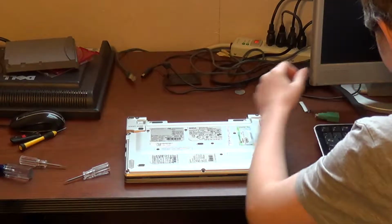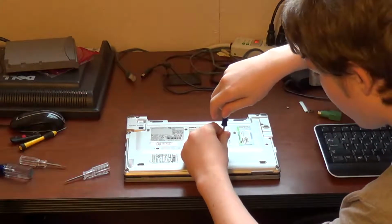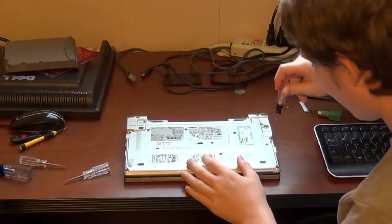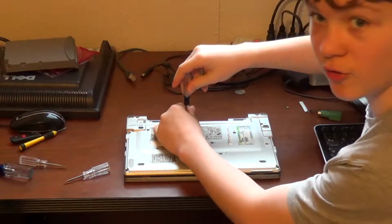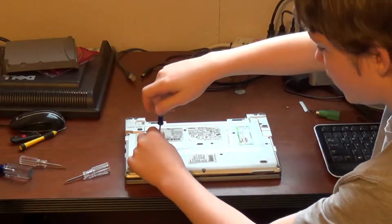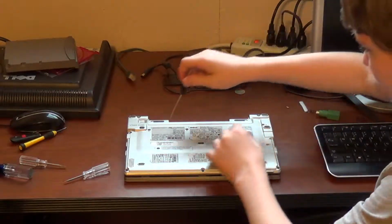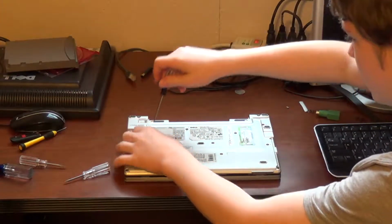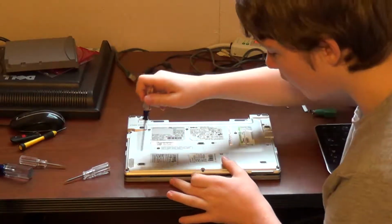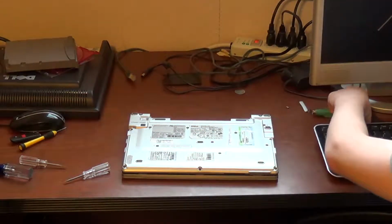Now, this netbook is not worth refurbishing and selling, because it only supports a maximum of 1 gigabyte DDR2 and decent capacity ATA5 drives with ZIF connectors on the end are just not here, and if there are, they are ridiculously expensive. These netbooks were made for their time, and that's about it. They're not meant to serve today's duties unless you're really light duty on these machines. The disc was almost full whenever I wiped it.